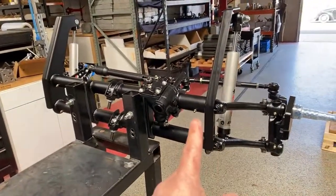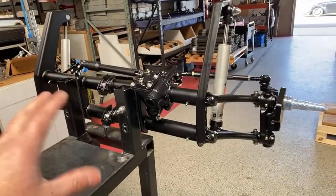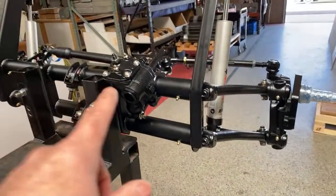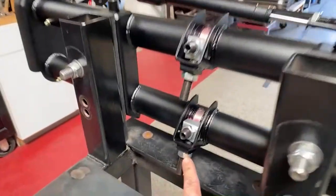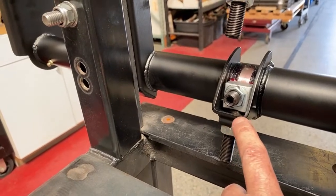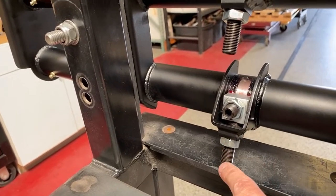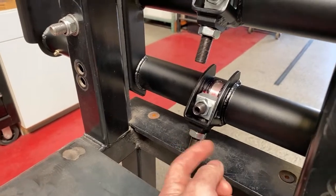All these beams come greased at all eight Zerks on the link pin models, including the steering box — all fully greased. Then we wipe it down clean; you won't find a speck of grease on this front end. A little tip: once you've got the right height set up, you'll want to shorten the adjuster. Measure from the block to the base, cut that amount off the top side — not the bottom, because there's an Allen on the bottom. Then you can bring it flush with the nut, which gives you good ground clearance.